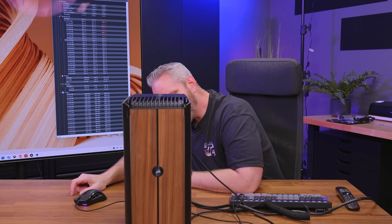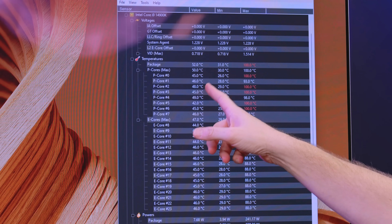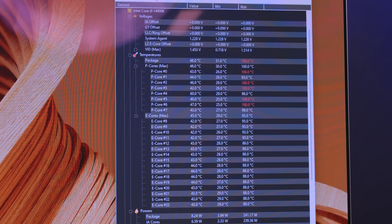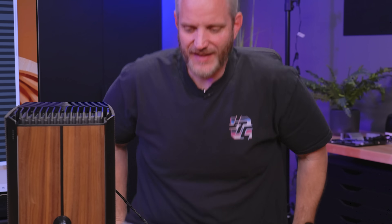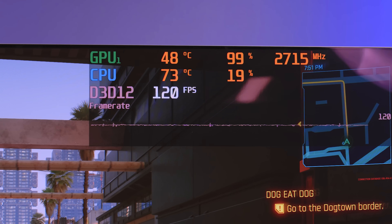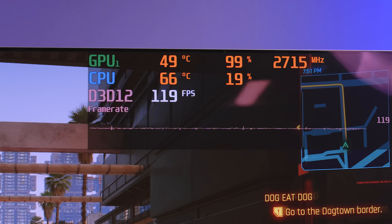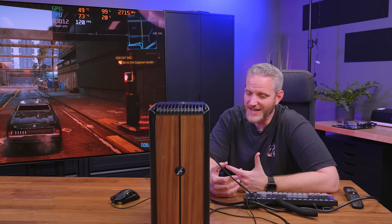I wish Noctua had made this just a little thicker — but that's still an improvement. The other big improvement: look how fast the temp comes down when I stop the test. Last time it sat at 70°C forever. Now it's already at 52, and cores are down to the 40s already. In Cyberpunk — remember last time it sat in the 90s after heat soaking the AIO — our GPU is now at 48–50°C versus 58–60°C before, and our CPU is in the 70s versus 90s.